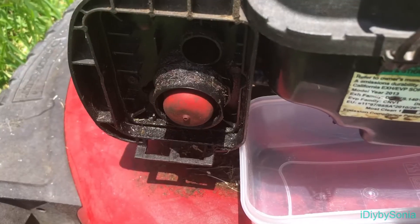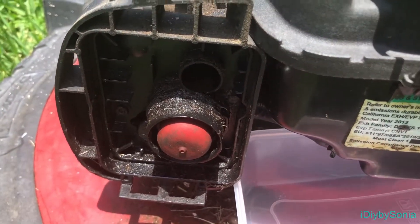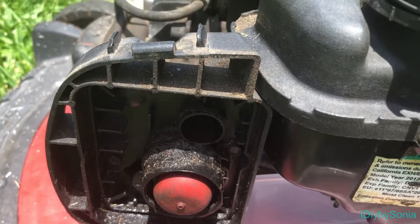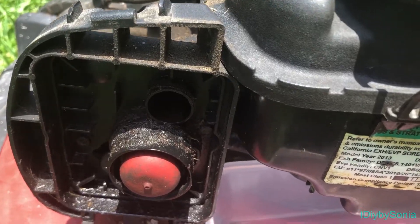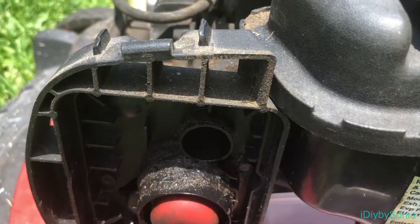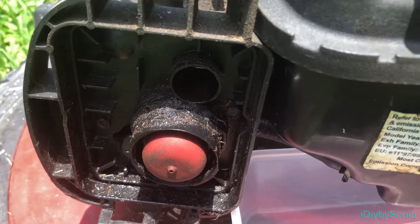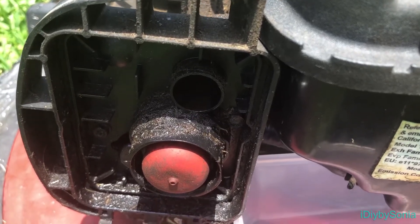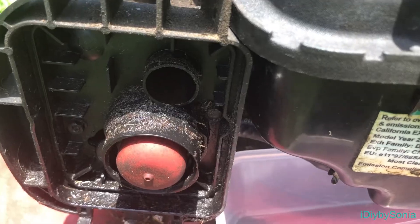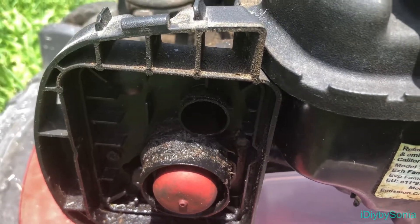As you can see, there's some — not condensation — that's gas, because I tried to crank it once and it wouldn't crank up. It's been like this for several days now, so that's why you see this moisture all around. That is gas. I pushed that little primer button about 19-20 times and it still wouldn't crank up and start. I changed the spark plug and it still wouldn't start. So now I'm going to pull the carburetor down and clean it out.